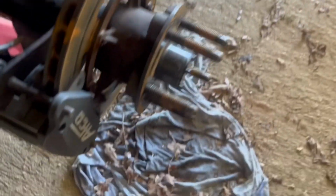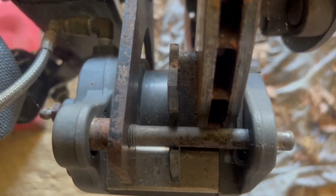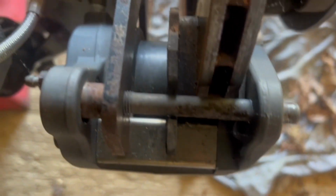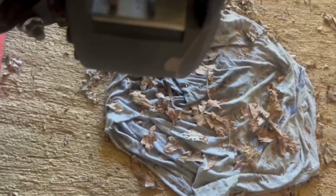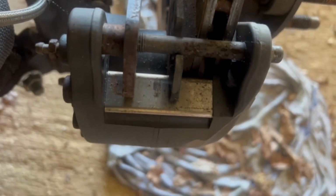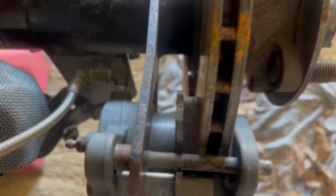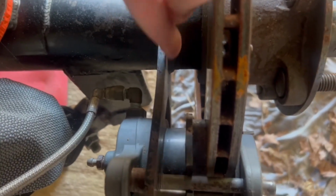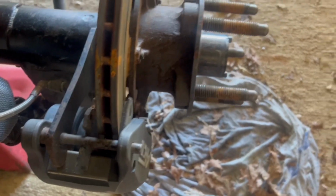It's the brake wear here. We got one side where the pads are fairly new, and the other side, I mean, it's completely shredded off up top. I'm hoping that the pad itself gave away and it's not something to do with my caliper being lined up incorrectly, but looking down on that caliper where it mounts, right here, it does kind of appear maybe bent. We're gonna take it off and put some new pads on anyway, check everything out.